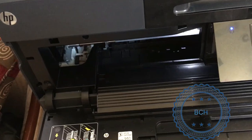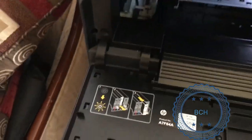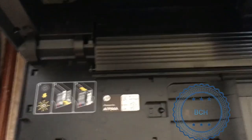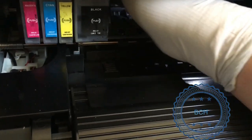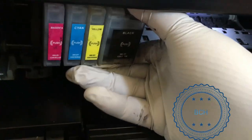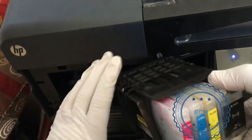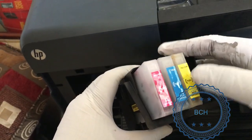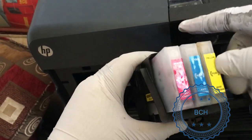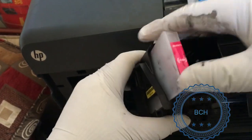Many HP and Canon printer printheads are very easy to remove — just pull up a lever and you can take the whole printhead out. However, Epson's printhead is secured to a plastic casing. You can search YouTube for the keyword: Epson plus model number plus printhead removal. If there is no YouTube video, focus on freeing the plastic tabs holding the assembly, then remove the electronic ribbons, and unscrew the printhead from its base. We will try to make more videos about removing Epson printheads later.